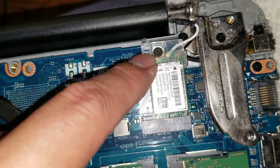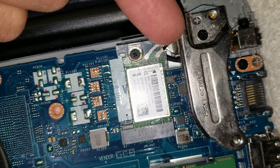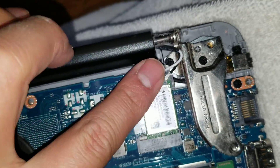There's the wireless card here with a little cover on it. To take the wireless antennas out, pull from the back of the tail — don't try to pry it from the front — and it should just flip up like that. When you push it back down, just line it up and push it in.